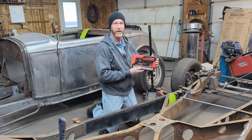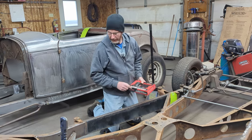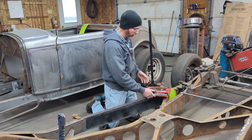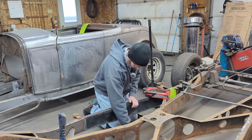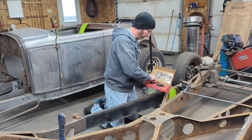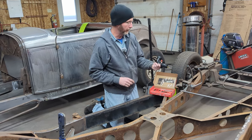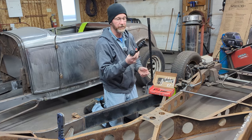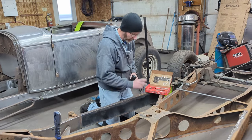So parts finally came in. I was waiting to get a master cylinder for the clutch. The master cylinder we got with it, I think, was out of an S10 or something, and the issue was that there was some sort of valve or something that stuck down way below the frame. So what we needed to do is get something more compact. There's a Wilwood master cylinder that you can buy for clutches. It's got a standard 3/8-24 fitting on here, so the intention is now to put that on the Welder Series bracket, and it would go here.